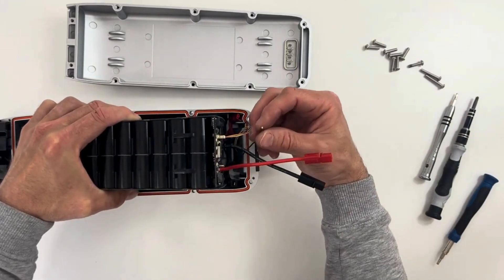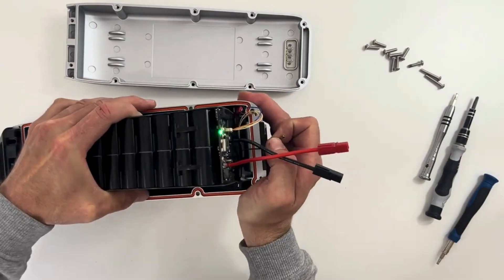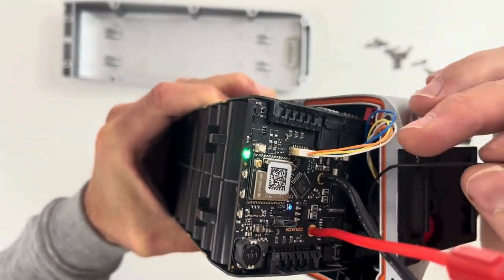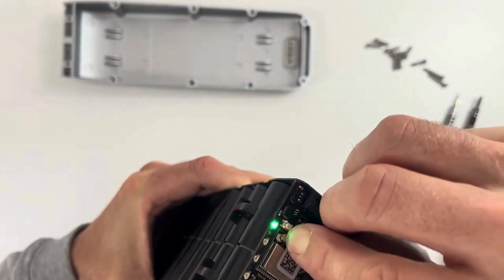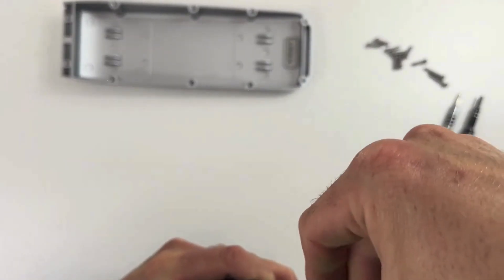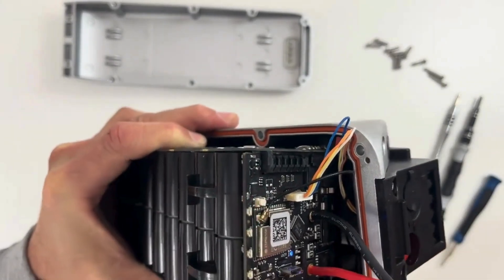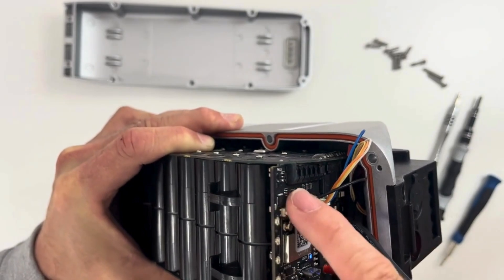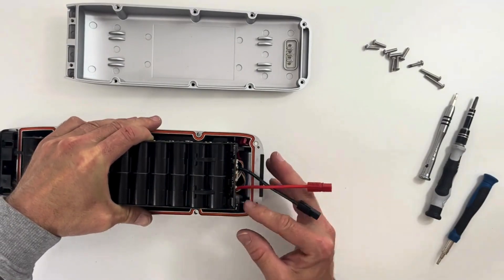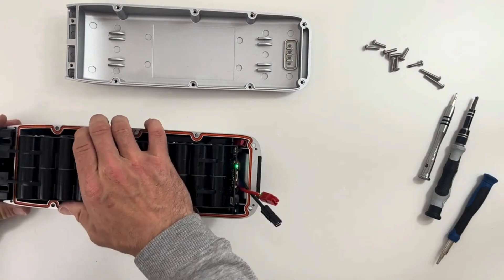The second part is the antenna, which is a bit more difficult to plug. There's a little plug here on top of the ESP32 — bring it in front, place it carefully, and with your finger press it down until you hear a little click. The cable should run between the reboot button and the ESP32 — that's the correct way. Then try to place those little cables in the center and gently let the pack go inside until it hits the bottom.